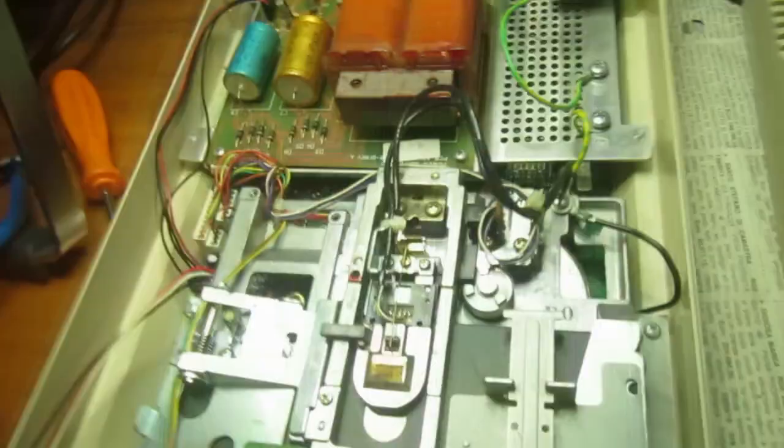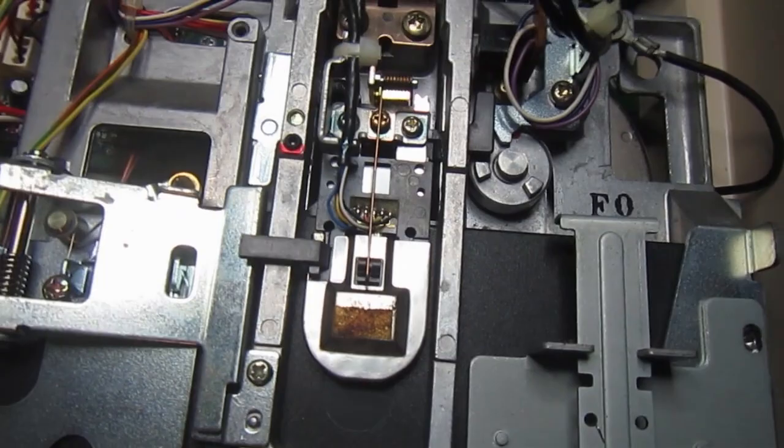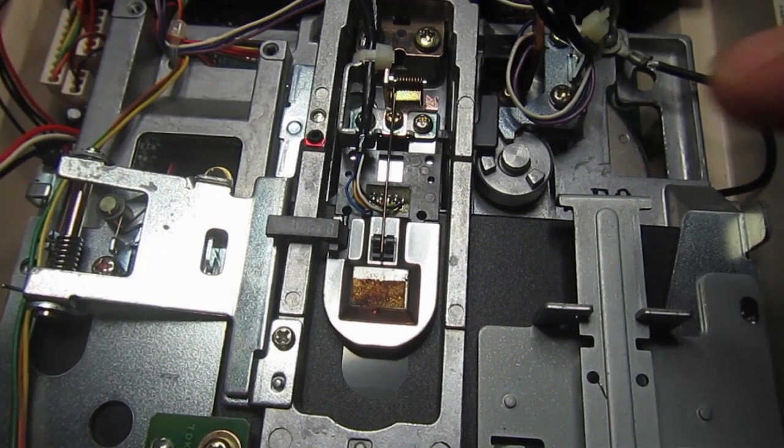Transplanting the track one tab for the sensor was the key fix. I wrote to the seller of this new old stock head and he didn't notice the broken tab either. I believe it's because I had the broken head under my eyes for some time before realizing a piece was missing. But anyway, it was possible to fix it. This is the 1571 - thank you for watching.